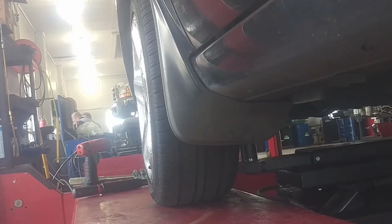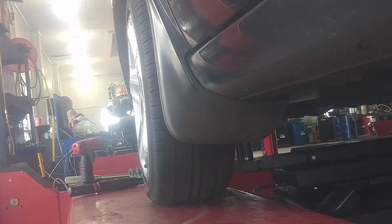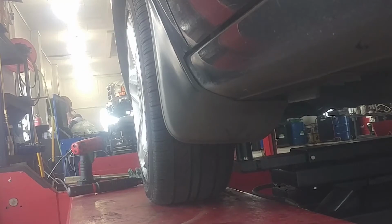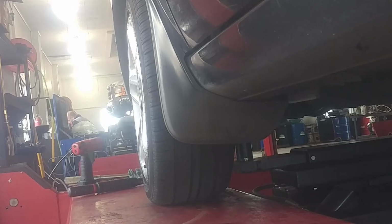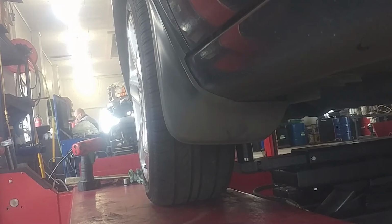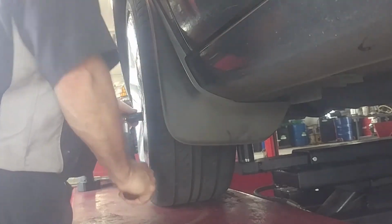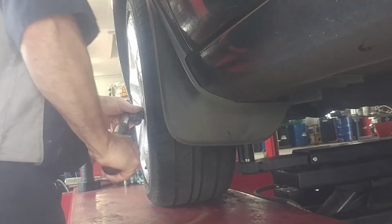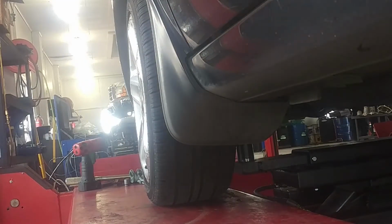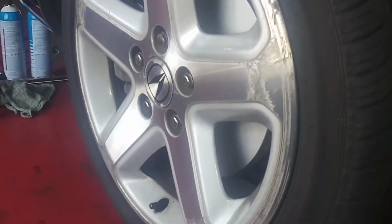Alright, our young oil change gentleman is fresh out of school in the last 3 years, so he says the way they're teaching him is to drop the tires so they just touch the ground and then torque them down. I don't know if it really matters if it's halfway down or all the way down, but here we are, halfway down. We'll torque them to 80 foot-pounds. We'll do the same for the other side, and then we'll head to the master cylinder and talk about that.